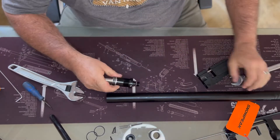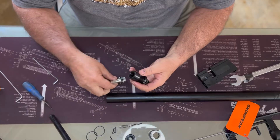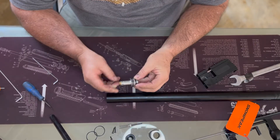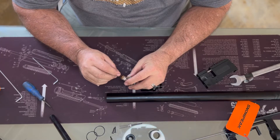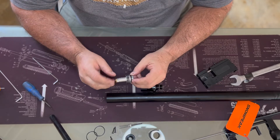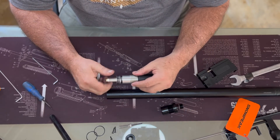It's very tight this one, so we're going to have to use two spanners to get it apart. Now we will be removing it from there. Just check that there's a little O-ring in there - it needs to go back onto the regulator. If you want to increase your regulator pressure, anti-clockwise will increase the pressure and clockwise will decrease it. We'll leave this one as is for now - this is just for demonstration purposes - and we will be fitting it back into the new power plenum.